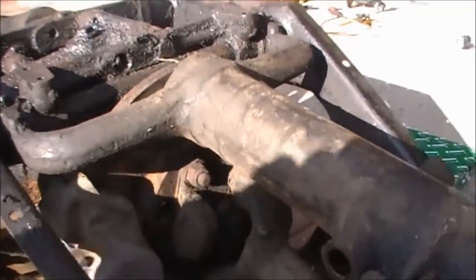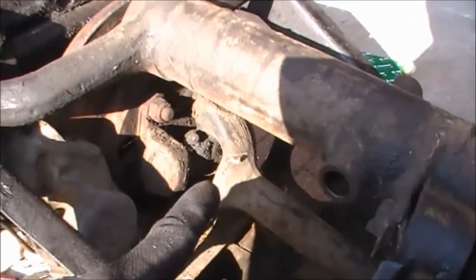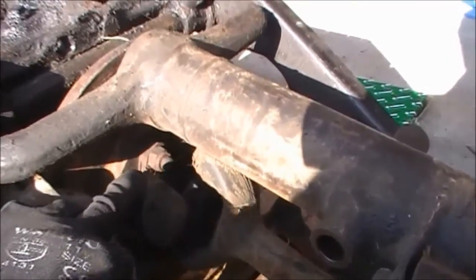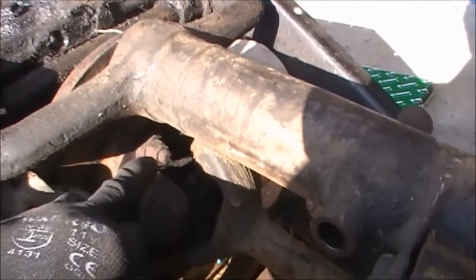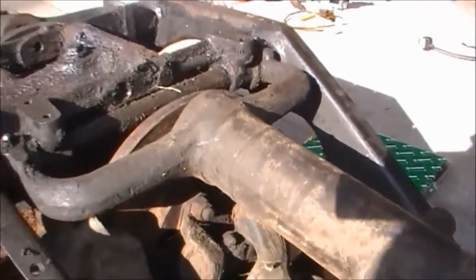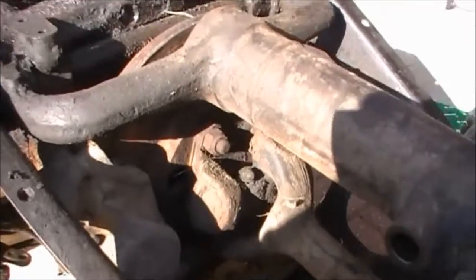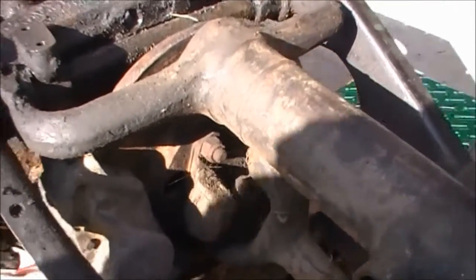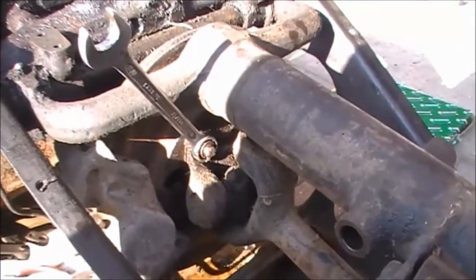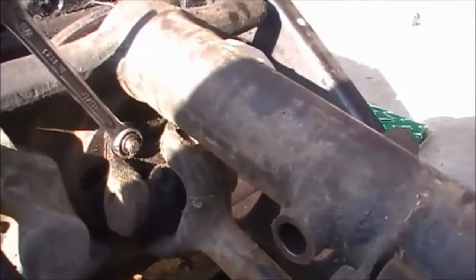The first job here is the drive shaft on this side, which comes along to this yoke. There's a UJ there and there are four bolts attaching that through the disc to the flange on the differential, and you've got to get a spanner in there and remove those four bolts. They are 11/16ths of an inch bolts.